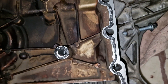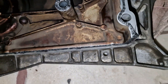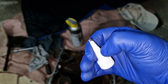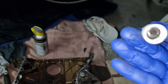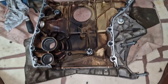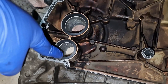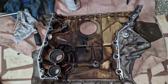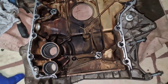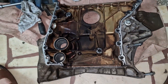I've applied the gasket maker — the bead isn't perfect but it's really hard to push out of the tube. I applied a bead here, a bead there, and on both sides. I'll let it sit for a minute or two before installing. I've also installed new o-rings, and I have a rubber mallet ready in case the cover needs persuasion to seat over the alignment pins.